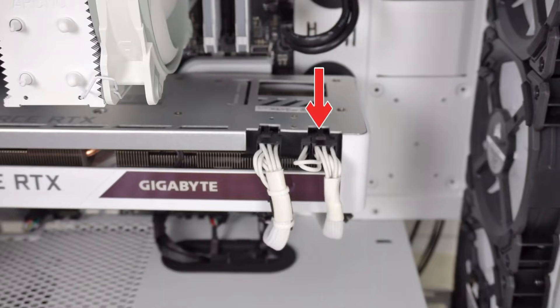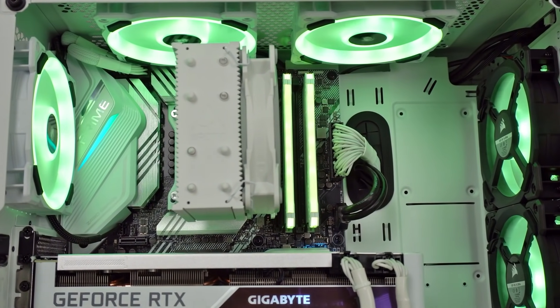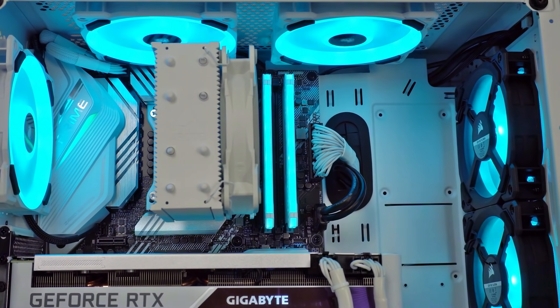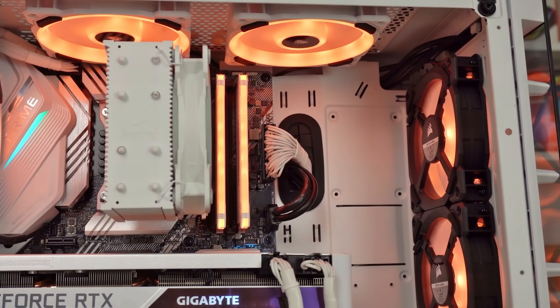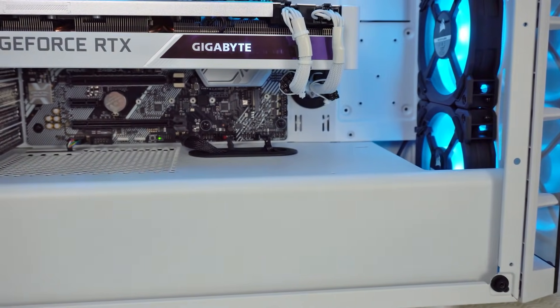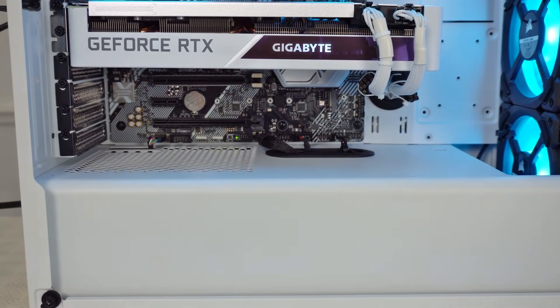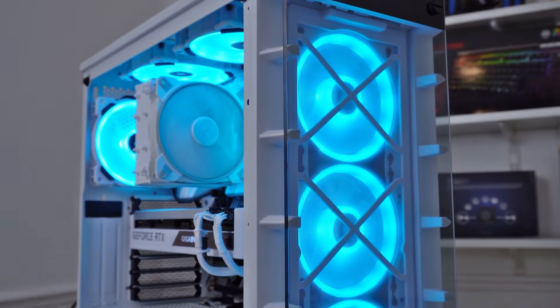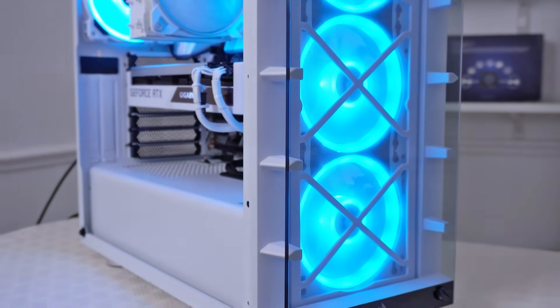Then plug in the 6-pin and 8-pin PCIe power connectors. All that's left is to tidy the cables at the back of the case and put the side panels back on. And here it is completely finished. I gave the motherboard a BIOS update, installed Windows 10 and installed all the necessary drivers. At the time of this recording, this computer is good for gaming at 1440p resolution or below and for playing some games at 4K. When running at idle or doing light work such as browsing the internet, this computer is very quiet. By the way, the graphics card's fans and the power supply's fan only spin up when needed. The white case really shows off the RGB lighting with its reflective surfaces, which just enhances the colour a little bit more.